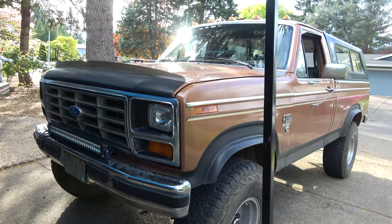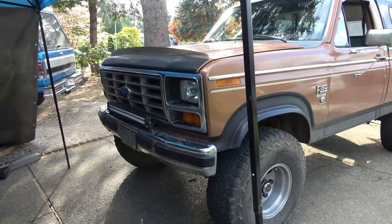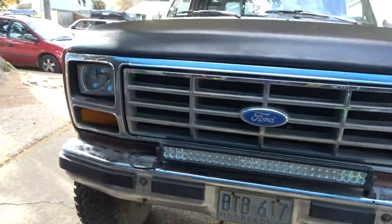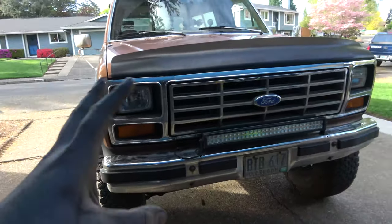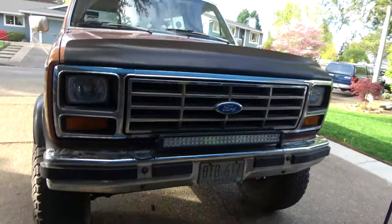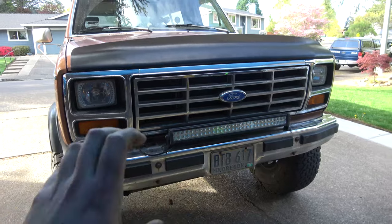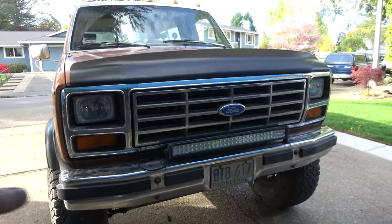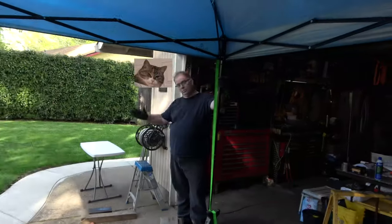I think that's going to be it guys. Thanks for watching and we'll catch you in the next video. I'll put a link in the description for all the parts down below. I'm going to go take her home and see how she does — hopefully no more wobble. Got my steering wheel a little more straight instead of being way off to one side, which is nicer. And because the track bar is straight now I can adjust it properly instead of having to pull an end out and ratchet-strap the truck over. Big thanks to Scott — I can't do it with my 110 welder, so yeah, that's it.